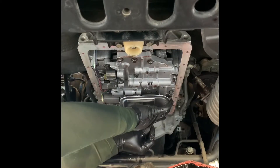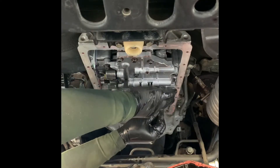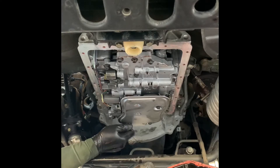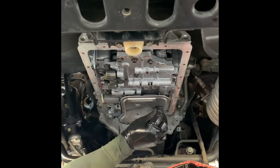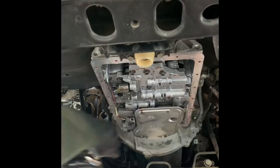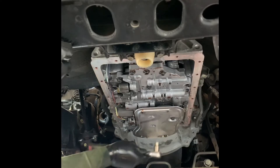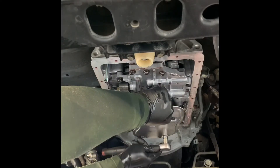Now there's also this other piece to deal with here. Just tighten the bolts down a tiny bit to get them started — don't even really put any tightness in yet. Make sure you align them all first, and once they're all aligned you can do them one by one and it should sit nice and straight. Get everything really nicely hand-tightened before you even start torquing them down. When you tighten these down, they barely need much — they weren't very tight when I released them. There you go — nice and tight.